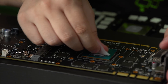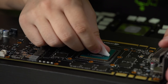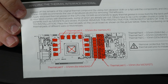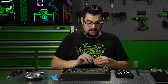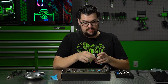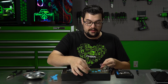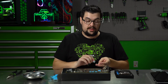Always remember to take off the old thermal paste using rubbing alcohol so there are no contaminants when you put on your new thermal paste. Now that we got the old cooler off, it's important to check the manual that comes with your water block to see where your new thermal pads are going to go. Peel off each thermal pad and put one on each of the VRM. Note that these have two pieces of plastic on them, one on each side, so be sure to take off the other side as well.